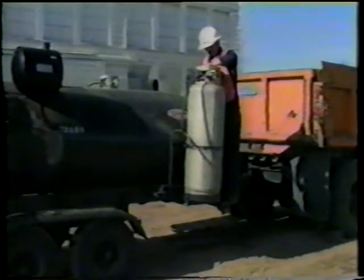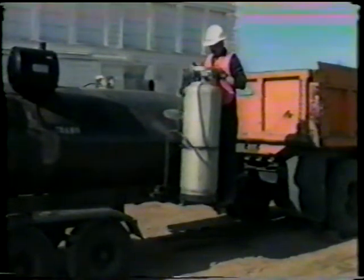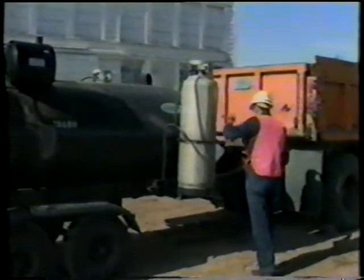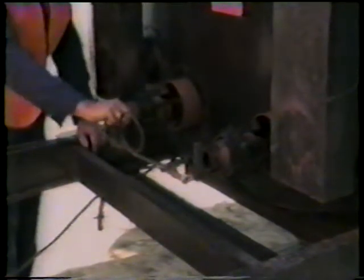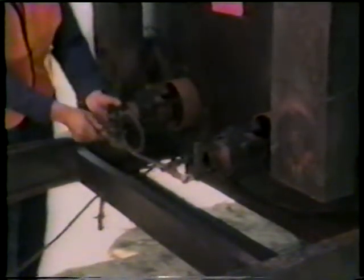Clean and check the gauge and the valve on top of the propane tank. Make sure the valve is shut off. Dismount and proceed to the burner valves. 14th, check both burner and main propane valve to make sure they are off. Also check your burner connections and set screw on top of each burner to make sure they are not loose.